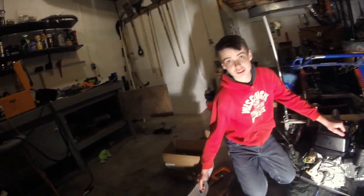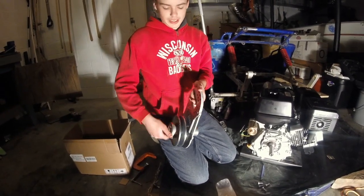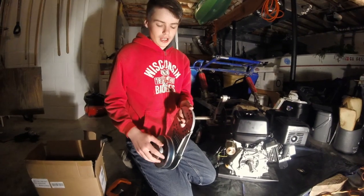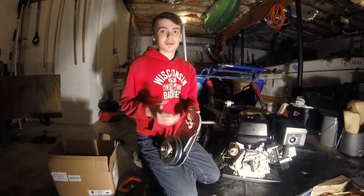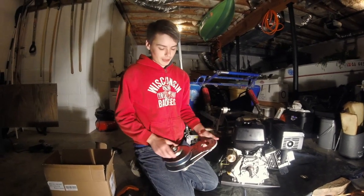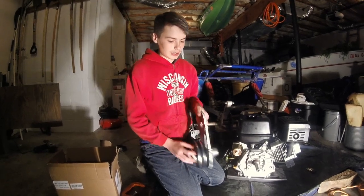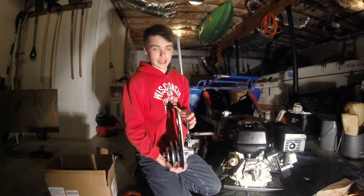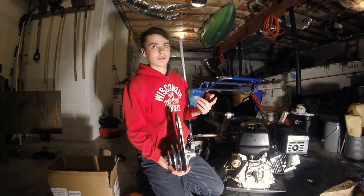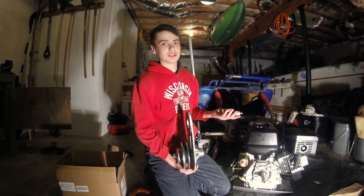The way I'm going to be doing this is through a torque converter. A torque converter is basically the fancier way of getting your power to your wheels. There's also another way which is a centrifugal clutch, which is cheaper, but this is going to give you more power and these aren't that much more expensive, so I highly recommend this. They tend to give you more torque — less top speed though — but if you have an off-road go-kart like I do, torque is more important to me than speed.